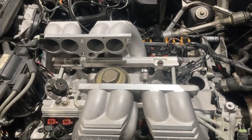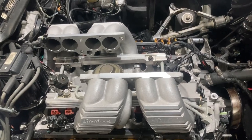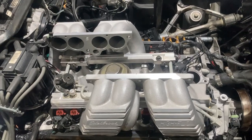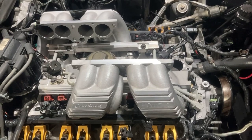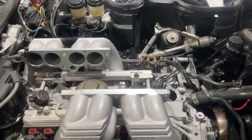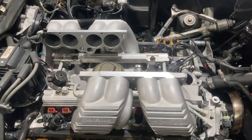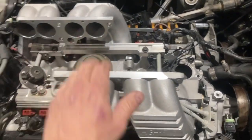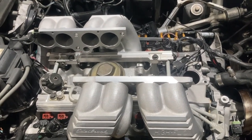The bandwidth torque on this thing — it'll run 2,000 RPMs up to 5,800 RPMs pulling 500 foot-pounds of torque most of that way. I'm not going to give you that scenario for your 350 because this has a blower and it runs about 8 to 10 pounds of boost. That's really what's setting this motor up, but that blower doesn't help the bandwidth. The bandwidth is all going to be based on this intake, and your RPM range is going to be right in there.